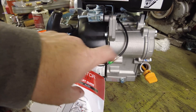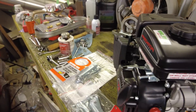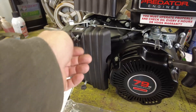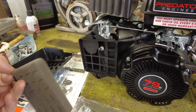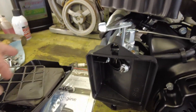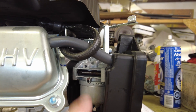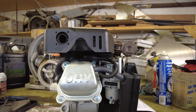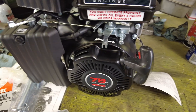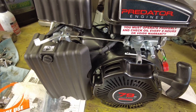There is no charge wiring coming out of this engine, so it won't have a charge coil, but that's okay because there's not really anything that needs to be charged on this. Similar size recoil to what we find on the 212 class engines. Under the cover, we have a foam style air filter — not very much foam there. Air box goes into the standard carb. Looks like one of the less expensive carbs, but it does have a drain so you can drain the fuel out of the float bowl when done. There's a flat style muffler on top. On the front we've got our choke and throttle. This is a governed engine — max speed is 3,600 RPM, which I believe is the exact same RPM as the Briggs we're replacing.